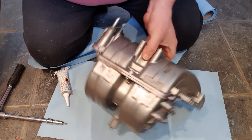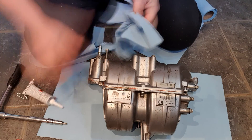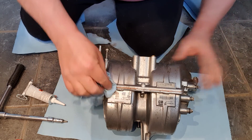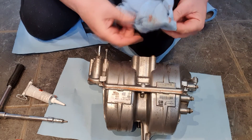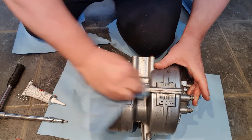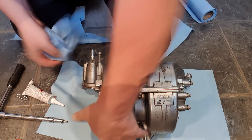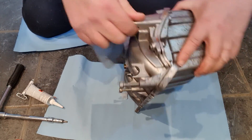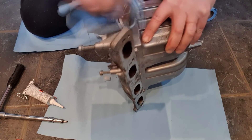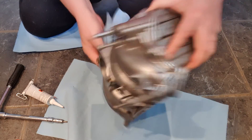I'm quite happy with that. Now as you can see, that's nipped down quite nicely because that tiny little bead of sealer that we put round there has actually oozed out a little bit - you can just see the little copper colour along there. So that means we've actually filled the spaces with the copper sealant. I'm just going to go round and wipe the excess off, because that means it's oozed out and made a seal, or assisted the rubber seal that was already in there.